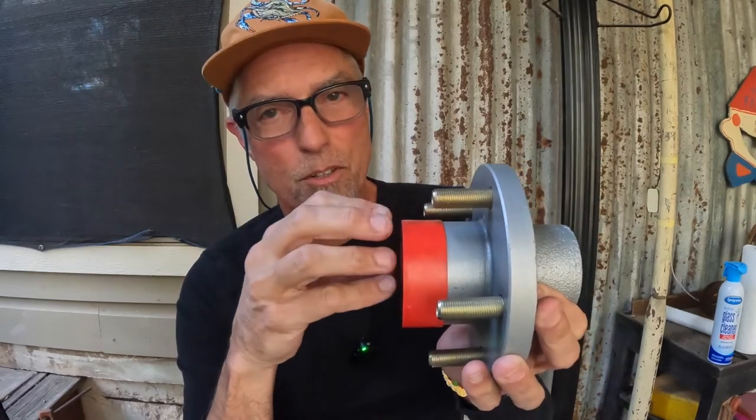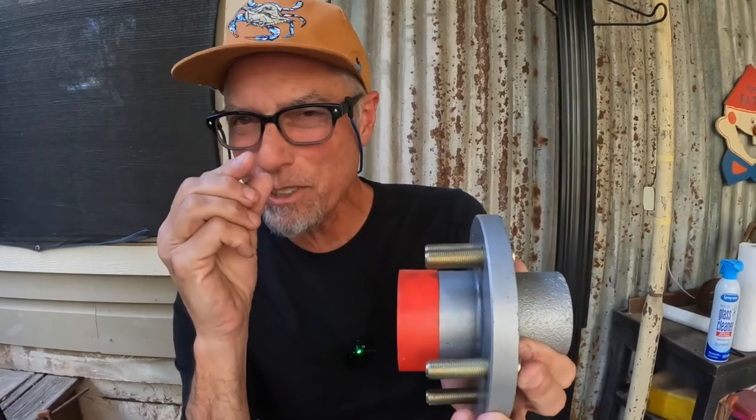Well, when it comes out on the spindle, just a hair, then you have trouble getting that cotter pin back in there. So you're gonna have to go to a thinner cotter pin to go in there, super thin. But when you think about it, once you've got it tightened down and set right, there's not a lot of stress on that. That's just like a safety thing. Don't leave it off. You cannot leave it off.